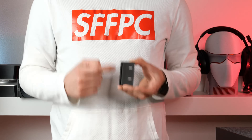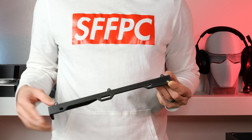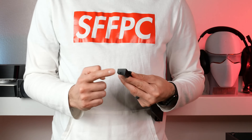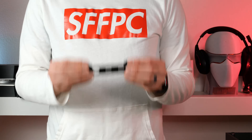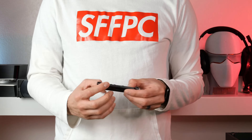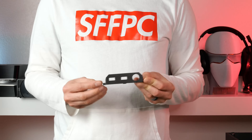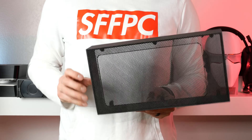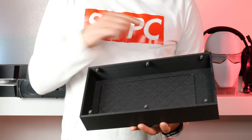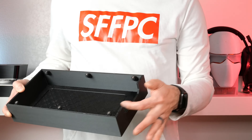This simple part has two screw holes in a slot for the GPU tab. Each radiator bracket has an insert for the power button part, three magnets for the front panel, screw holes for the fans, and more holes for the top and bottom. The front I/O has protrusions and indents, two mounting holes, a slide rail system, and a 19mm buttonhole and USB holes. Lastly, the front panel must be printed as a mesh to feed air to the radiator. It has protrusions and indents all along its edges, six magnets, and a slide rail system for the I/O area.